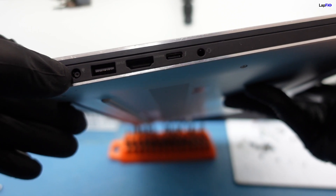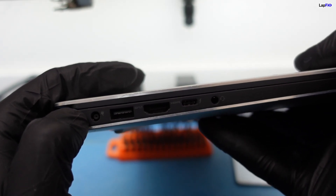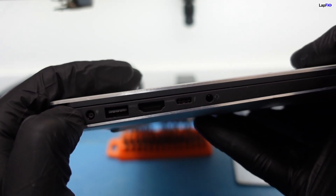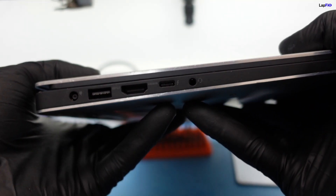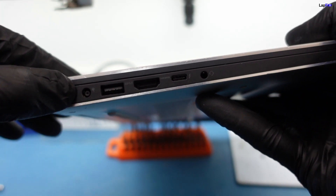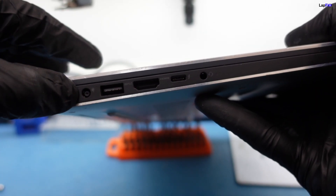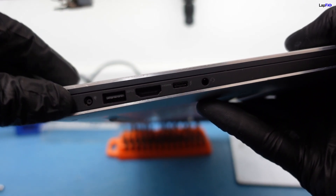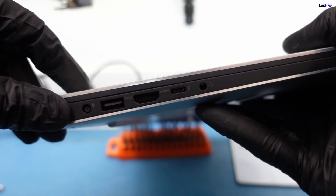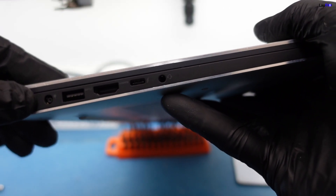If you get the right angle, there's a pin in there covered by plastic. This piece of plastic is actually covering a metal piece which gets the connectivity for your DC jack to connect to the laptop to charge the battery. I'll put an example here of a damaged DC jack — you can see the metal surrounding it. It's really dangerous to plug it in if it's in that position; you would need to replace the jack because you can harm the computer. Metal touching metal can short the laptop, which is really dangerous.